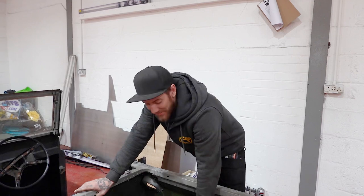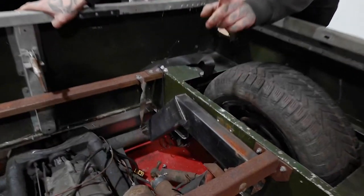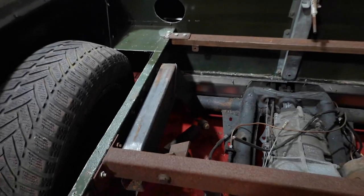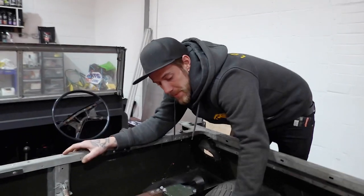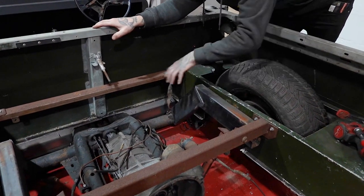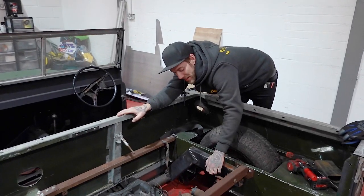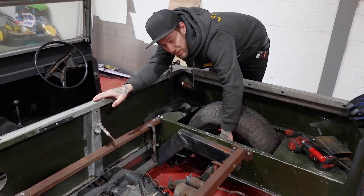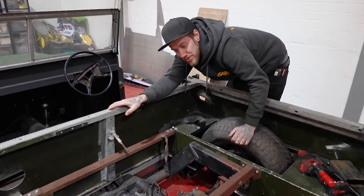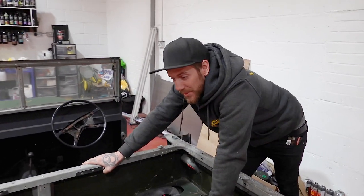Following on from earlier, this is basically the design we're going to use to do the rear bags. I'm going to make these two rails - there are a few clips of them being made. They'll join back onto this cross member, which is then joined to the bottom of the gearbox cradle. That will then create a back half, essentially like what you've got on a truck, where they mount the bags on here and come out to where the arms are bolted onto the axles. Bottom of the bag there, top here - and that will be just a standalone chassis.